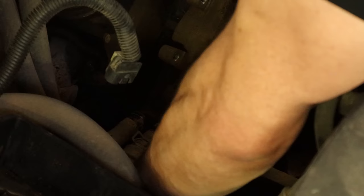The truck is clean enough to take it out on the road and be seen in public. So I'm going to go take it for a little ride and see if we can set the monitors, see if we get any check engine lights — I'd be willing to bet we're going to get one. These older ones are known for knock sensors, so that'd be my bet as to why the light will come on. I'm going to go take a drive and see if I was right. See you guys in the next video, thanks for watching — let's give it a shot.